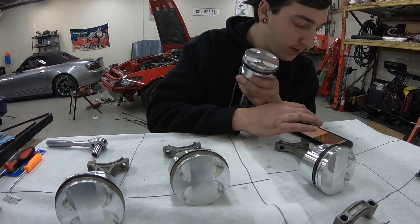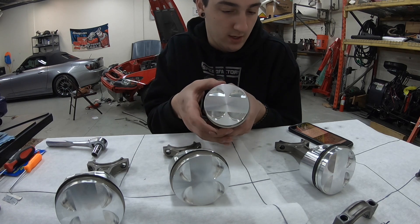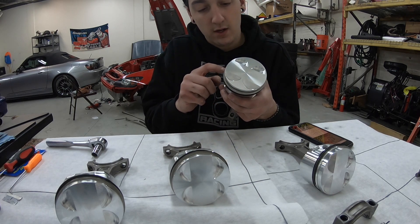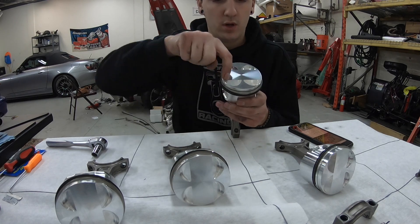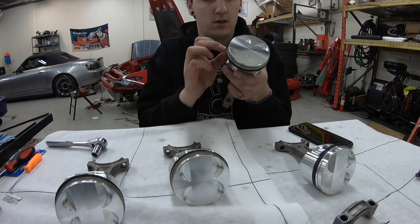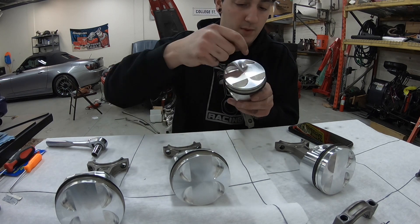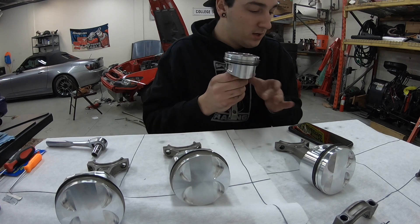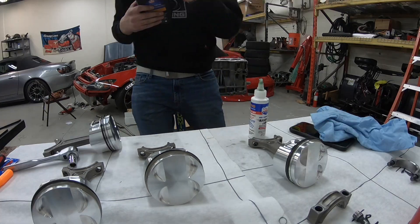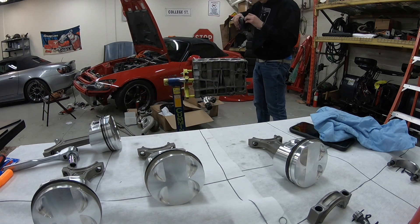Alright, so you can clearly tell the fronts and backs, but I'm going to take all the caps off and write on the back of each one — one, two, three, and four — so I know what's what when I take it apart. The top ring and the second ring have to be completely 180 degrees from each other. The top ring gap is on this side and the bottom compression ring gap is on that side. Then the oil ring — the three parts: the top one at this corner, the middle ring gap completely to the side, and the bottom one at this corner. I'm going to set it in 40 weight oil and put a little bit on the sleeves.